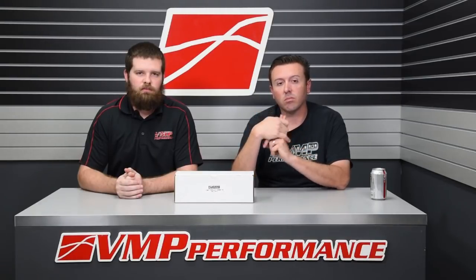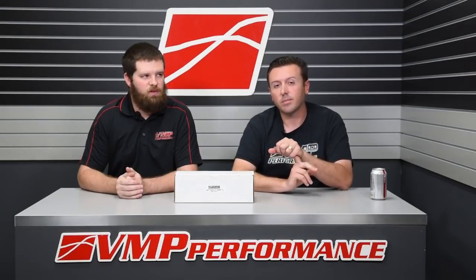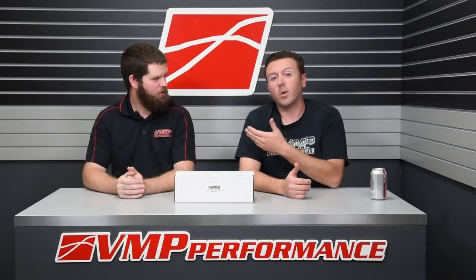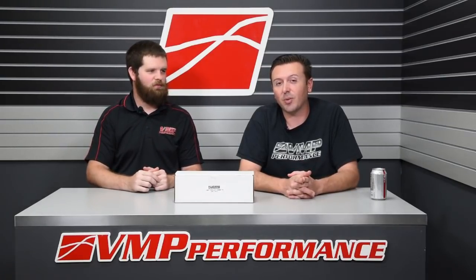While you guys are talking about trucks, what does a VMP kit do wheel horsepower wise to a 6.2 Raptor? Did you say 470 to 490 wheel is typical for a Raptor? Well, since you had one on the dyno Monday, Joe, you have firsthand experience. Yeah, that's pretty typical. 93 octane, sea level, Dynojet, asterisk, asterisk. That's about what they make. Our kit's very similar to the Roush kit. It's just turned up a little bit more as far as boost, with a smaller pulley and our own calibration.